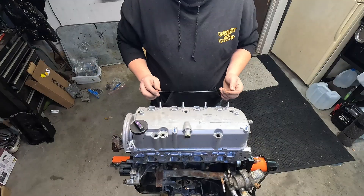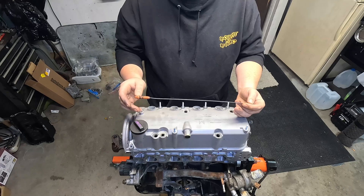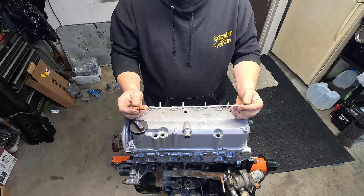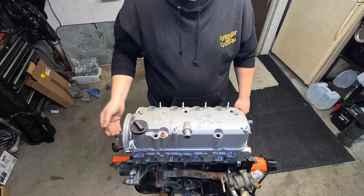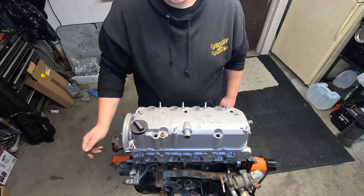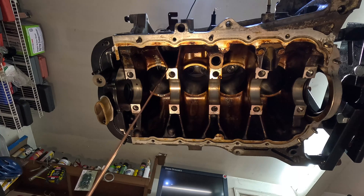Now that we've got the new valve cover on, we can go ahead and make sure the dipstick is going to reach the oil pan without any obstructions. Sadly the only piece I'm missing to complete this entire swap is the dipstick — I do have one on order but I didn't have a D17 dipstick laying around, so we're going to use our D16 dipstick. It's a little bit short but it'll still do the job. I'll put some welding wire on it just to show you guys where it's going to come through the block. And as you can see, it goes right down through the valve cover, through the head, through the block, and luckily it comes out of the drain back that is not blocked off. It comes right down to where the oil pan would be without any issue — nice and free flowing. There's going to be plenty of room around that dipstick for the oil to continue to drain back.